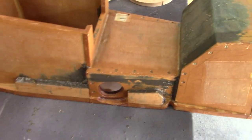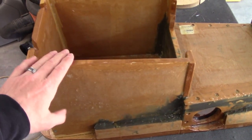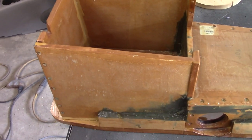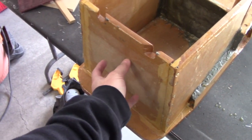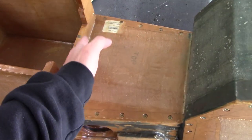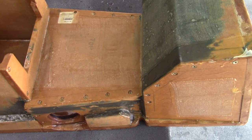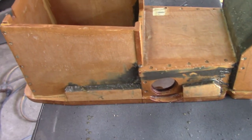All right, there it is. I'm not fully fiberglassing the whole thing. I'm just putting fiberglass especially on the box portion here, because that's half inch MDF. Just fiberglass here, inside. One layer each. I had extra pieces, so that ended up being more layers back there, but that's fine. I took a piece and ran it here, here, here, continuous, and I'm looking to seal any of the joints that I had problems with. I would bet they're already sealed by the Bondo glass.